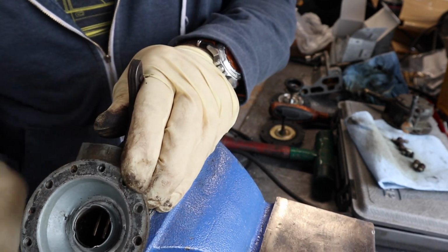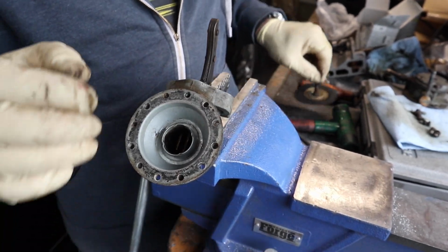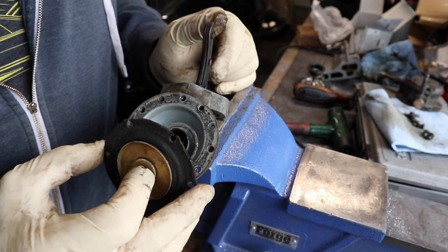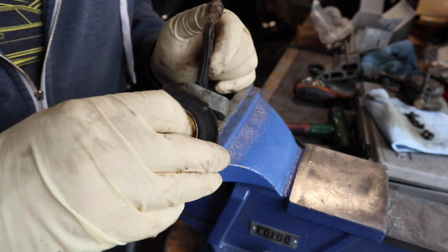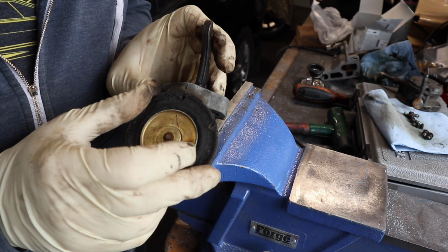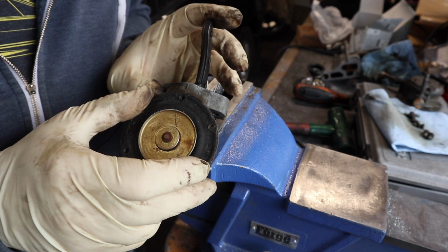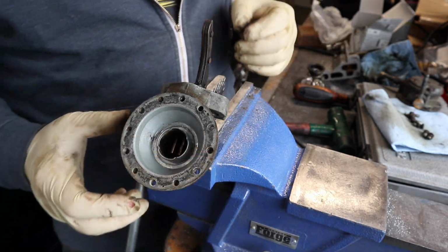When you're putting this back together, it might help to put a little Sharpie mark on your orientation, but this is going to drop down in between those two, and then you'll twist it 90 degrees. And when your lever arm actuates, you can actually see that that is what pulls the diaphragm down and sucks in the fuel, and then the diaphragm pops back up. So that is the inner workings of this fuel pump.